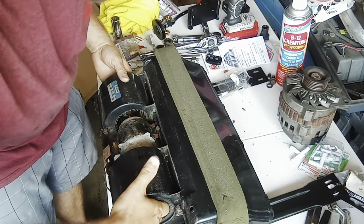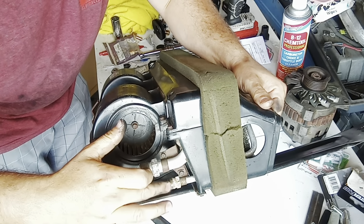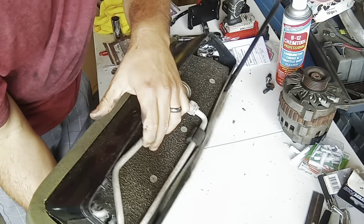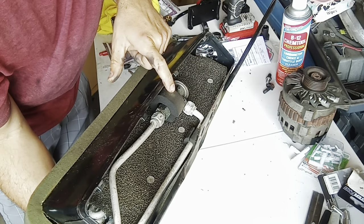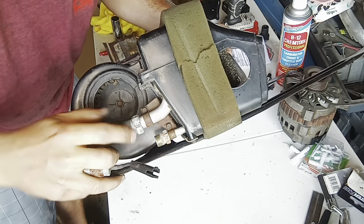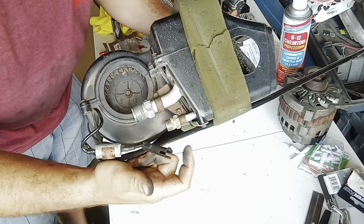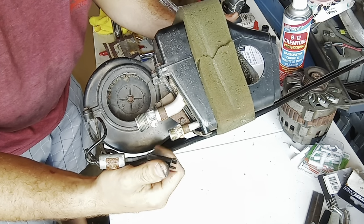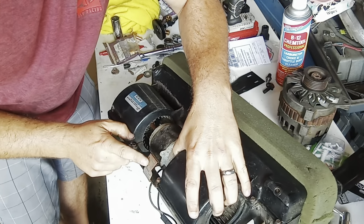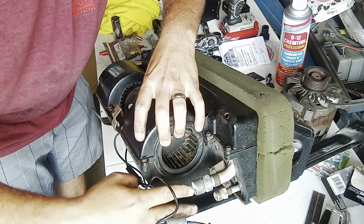So I had to repair that, but I needed to get these two lines off to get it off of the roof. This line and this line are your AC lines going to this rear evaporator coil in here, and then I got a new pressure switch going right here that I need to replace. But as far as these two lines, this one was a 7/8 here, and I used an adjustable because I didn't have one to fit it, but it's probably a 1 inch or an inch 16th. And this was a 5/8 and a 3/4. You get these two off and get this off that holds the two lines running right here. You'll see them running down this way, and then they'll come down here and tie into these.